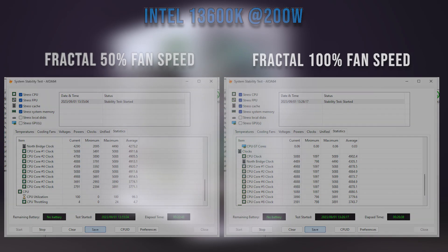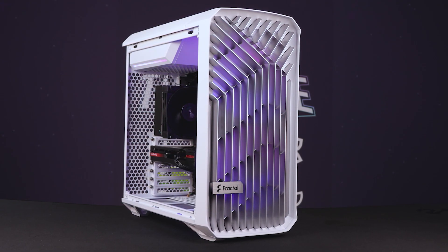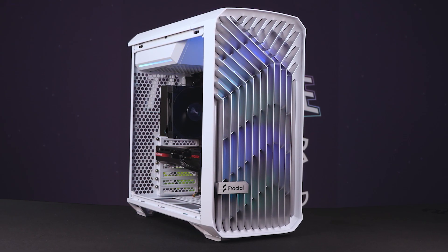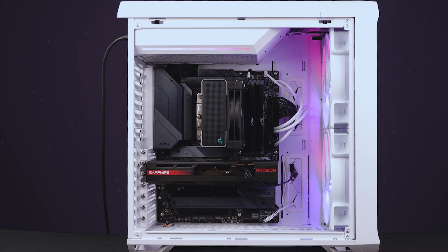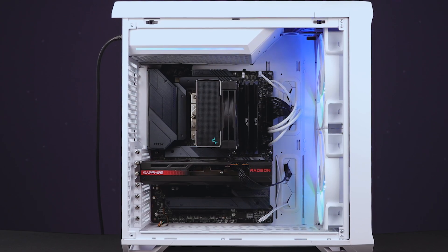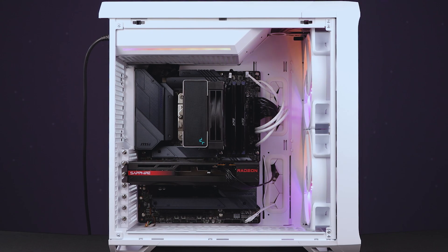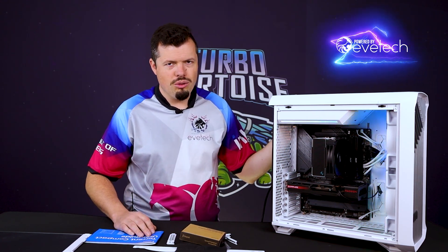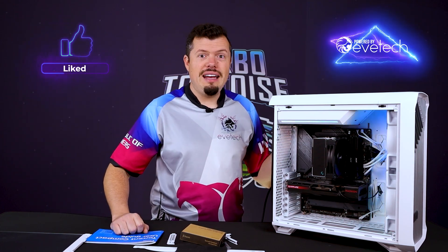So yeah, I think it's a cool, unique take. I don't like the bottom mount idea for water cooling — the high point is going to be the pump and it's going to get full of air. If you were to do that, you'd have to remove the two big 180s up front and use the rails instead, which kind of defeats the purpose of the case. Premium air-cooled though — I think it's fantastic for that. It's got a couple of mounts at the back for two-and-a-half inch SSDs, but you're going to want most of your storage on your motherboard. If you're spending 2,700 Rand on a case, even more power to you to put everything on the motherboard. There is also a smaller build which I think would make a brilliant MATX build — I actually want one for my MATX setup for that 180mm fan up front. Anyway, that's all I have for you on the Fractal Torrent. If you've enjoyed this review, please hit us up with a like and subscribe.